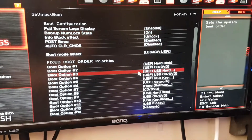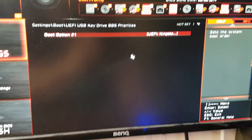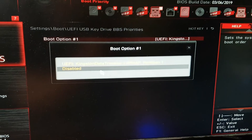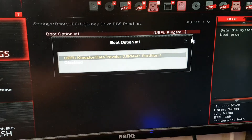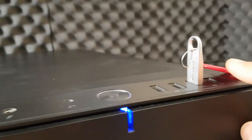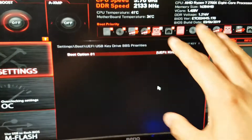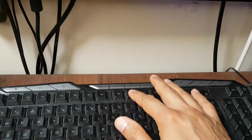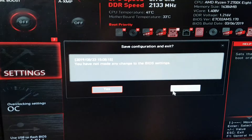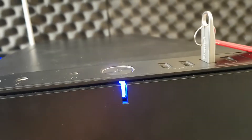If you can't find it, scroll down and look for UEFI USB key drive BBS priorities — make sure it's there. In our case it is there: UEFI Kingston Data Traveller. If your USB isn't booting up, it could simply be a question of setting the correct boot order in your BIOS or UEFI. Once you've made the necessary changes, hit F10 to save and reboot, and we should now boot straight into the USB drive and start the installation.